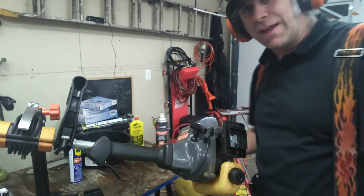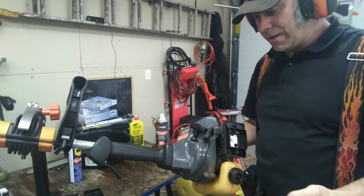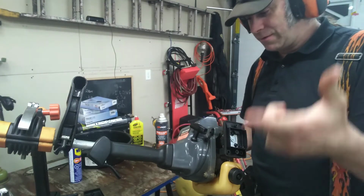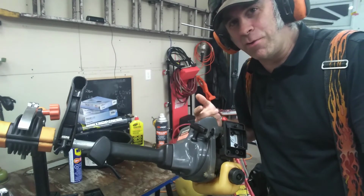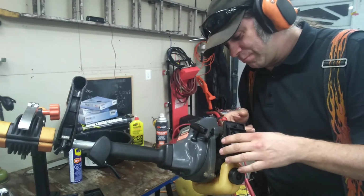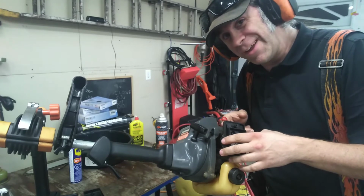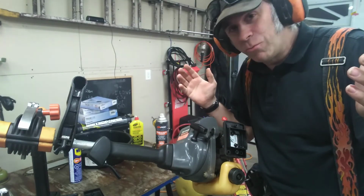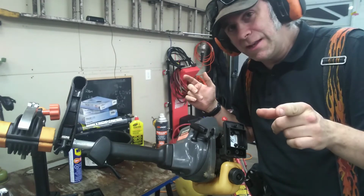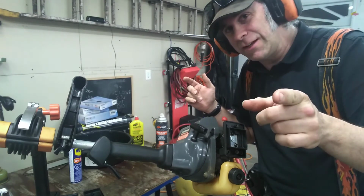So now you don't have to take anything else apart. You know, okay, it's got compression, it's got spark. So you can tear into that carburetor and, you know, replace that diaphragm kit. Maybe just a diaphragm, meter diaphragm. Real cheap. So let's get into that next. So that's the next video for you.